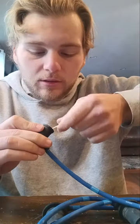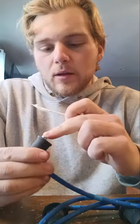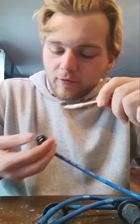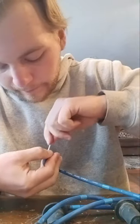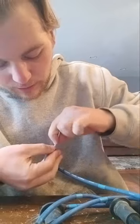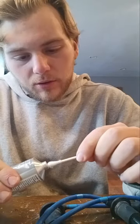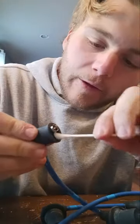So do your best to be careful. Go ahead, get your Q-tip — you can move it a little bit if you have some like mine. This is for an N.A. Miata, so they have a smaller style spark plug boot. You don't need much — just get a little bit on the Q-tip and rub it around the inside of the boot nice and well.